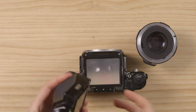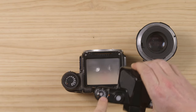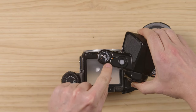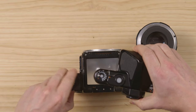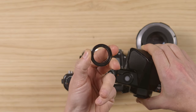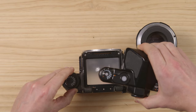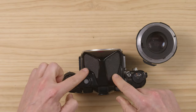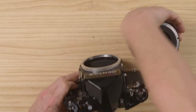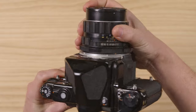So now that I've taken off the lens, I can put the TTL prism again. When you're putting on the TTL prism, do make sure that you have the same shutter speed here — so if it says 1/25th of a second, it has to say 1/25th of a second. You need this little ring, which can be a pain if you lose it — they sell them on eBay, they're like 40 bucks. So you put the little ring — there's no set position to that — and you put your prism, here are the clicks. And then once you do that, you can grab your lens and put it back on.